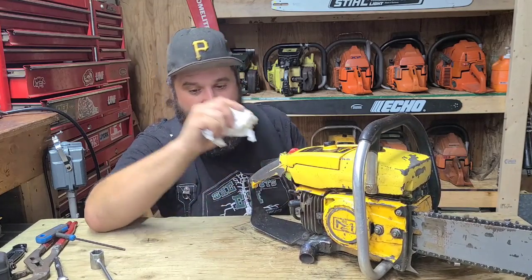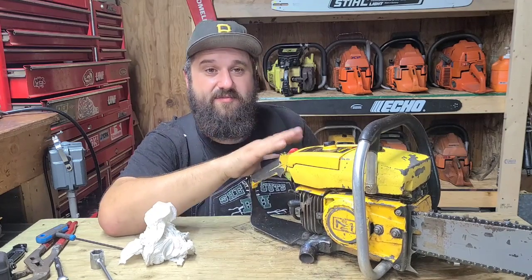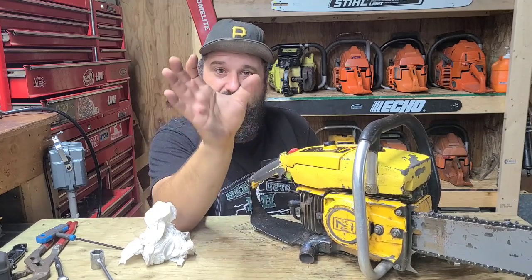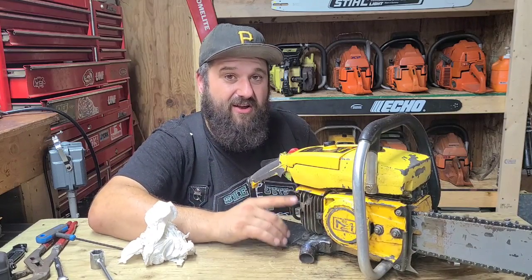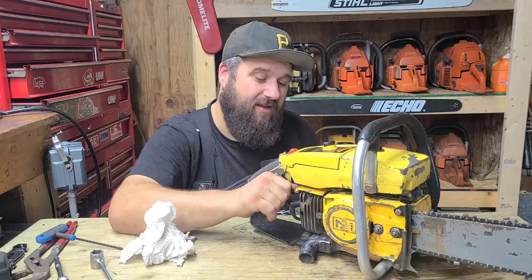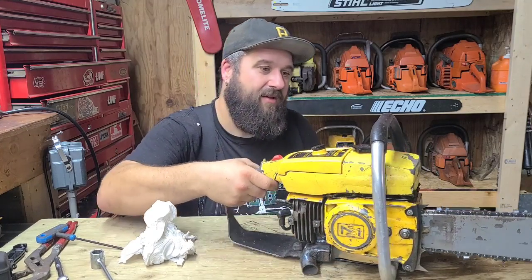So be aware. And also, here's what I'm learning. These Macs have very short intake timing, but they have very wide intakes. If you start dropping the cylinders on these, you're adding a lot of intake timing. You got to be careful. Macs do not seem to tolerate intake timing like a regular saw. So that's what I know about them.